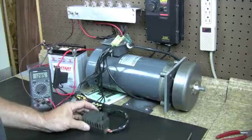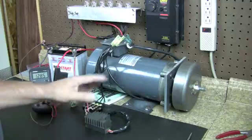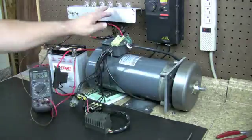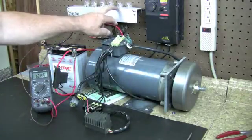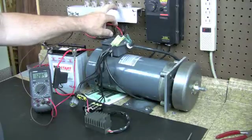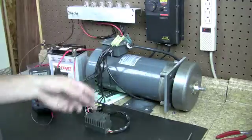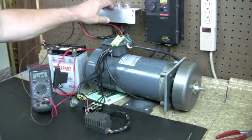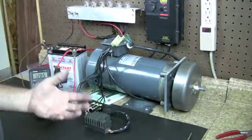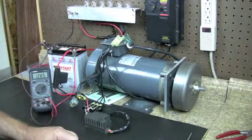The regulator is a very important part of the puzzle here. So what I'm going to do, I'm just going to fire it up to show you how it works. Up here on top is a load cell that I made with 1157 bulbs, like from taillights of our motorcycles or cars. Newer ones are coming out with LEDs, but I use these because they pull more power and give us more of a load.